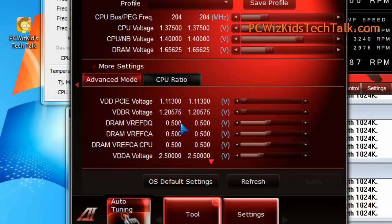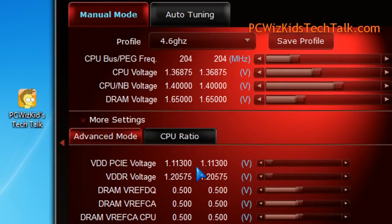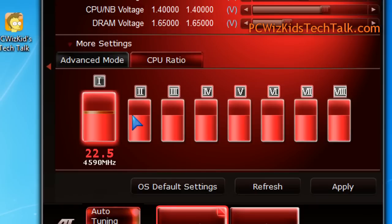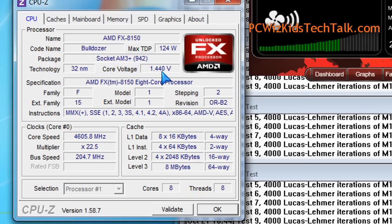Things seem to be running well on auto. As long as I disable all the power management features — disable turbo mode, disable anything that restricted the extreme overclocking I'm trying to do — then things were basically stable, and that's where I wanted to be. 4.6 GHz gave me nice stable performance. That's about a 20 to 30 percent gain depending on what applications you're running, which is a huge overclocking improvement compared to previous videos I've done on AMD chips.